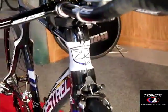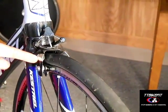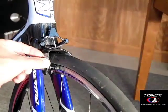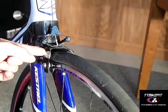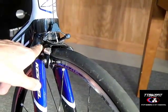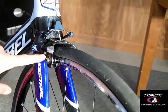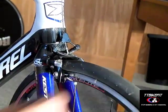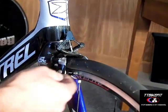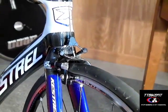I've been asked about these silver parts on the brake. These are basically cosmetic covers — just put your fingernail or a screwdriver under there and they'll pop right off. Underneath are your fastening bolts for the brakes, which go right into the studs that come out of the frame. You use a 5mm wrench to actually remove the whole caliper, though there's typically no reason to do that.